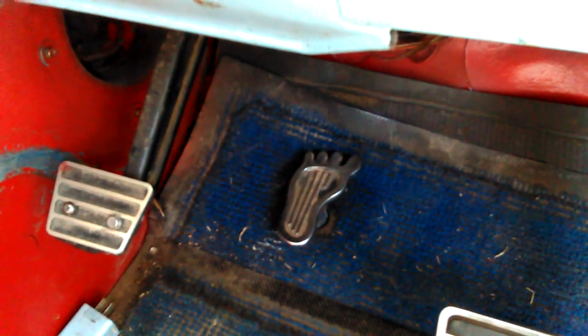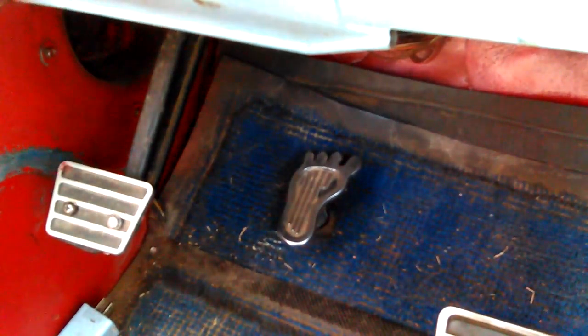I think I'll go get my test lamp because maybe if I use it as a ground, it will actually cause it to make a circuit. Be right back. I can hook my, see, the point on it can go into the connector and then I can hook that on the ground. Oh, let's see. I think this pedal is a good ground if I remember right. Comes on. Oh, I touched the power. Okay, I didn't mean to, but that tested it.